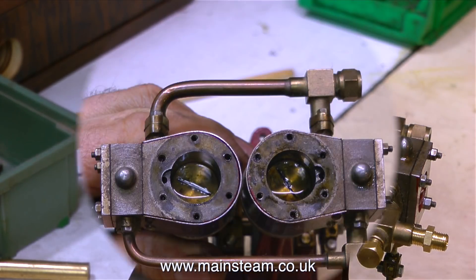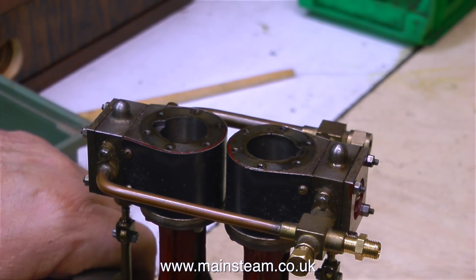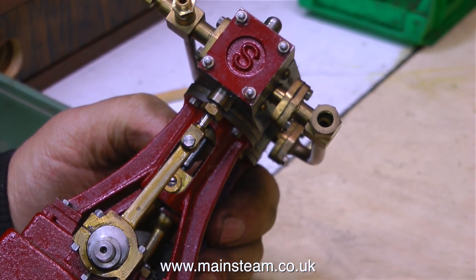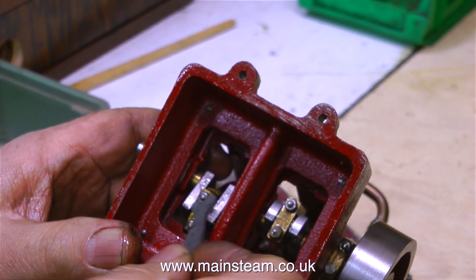I was very pleased to see that both of the pistons are slotted, so I can get a screwdriver in the top and rotate the pistons and remove them if necessary. But the very fact that the pistons rotate tells me that is not the problem — if the pistons were stuck in the cylinder, they wouldn't rotate. So I haven't removed them; I've left them where they are.